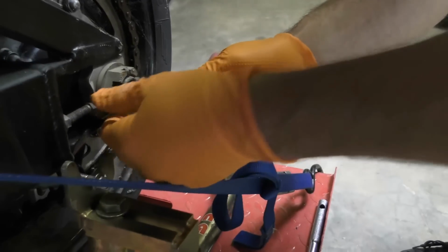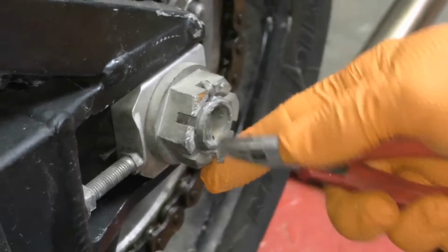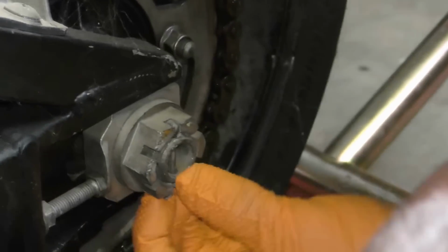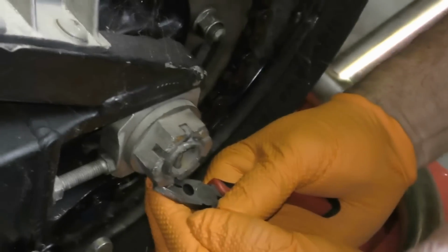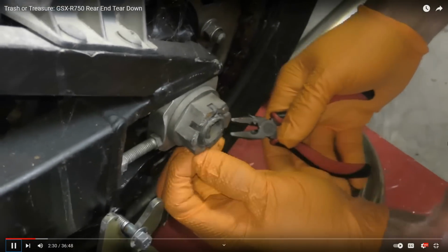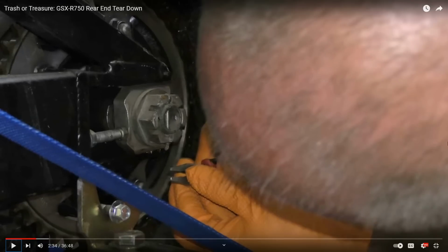There's nothing on the back side, so it's just this. You're making a bell end of that, Dave. Oh, did he just tap it with the sides of some pliers? Jesus Christ. Oh, what you can do. If you have got some really chunky side cutters that have got narrow noses and that are beefy enough, if you can get it there, you just cut it there and this falls out and that falls out and you're all laughing and all good.